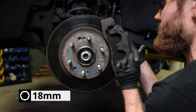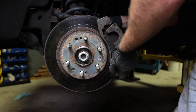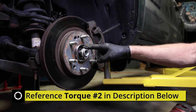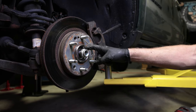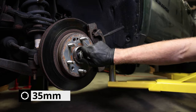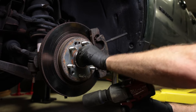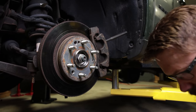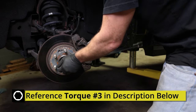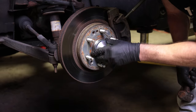I always like to put a little bit of anti-seize on my caliper bolts — just be careful because that can change the torque spec. Now we're going to drive the new nut on with the impact — again it's 35mm — and make sure your washer is on. Once this is touching we're going to torque it down. Got our drift pin back in place and we're going to torque it down. Let's add the cap on top.